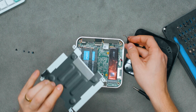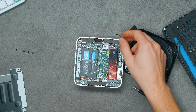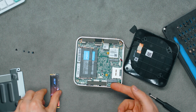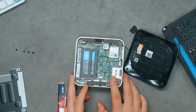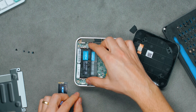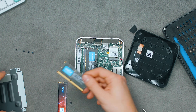Inside, there's a heat sink to cool the SSD — an Acer N5000 SSD. I accidentally pulled one of the antennas off, but it's easy to fix by removing the M.2 SSD, which is very easily replaceable. The SD card reader connects in from the side — a nice touch that Geekom is applying to many of their mini PCs, which creators will appreciate. There are Crucial SO-DIMM sticks of DDR5 RAM — 16 GB per stick at 5,600 MT/s — very easily upgradable.